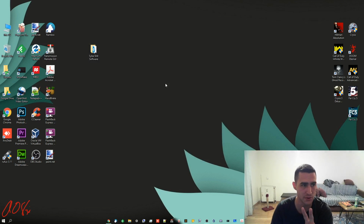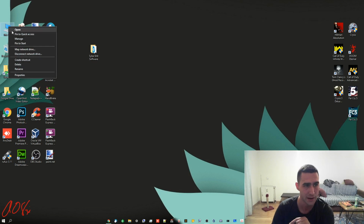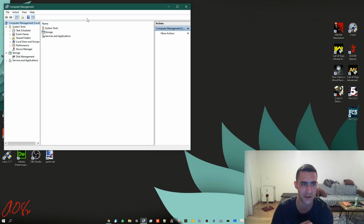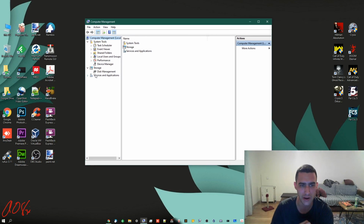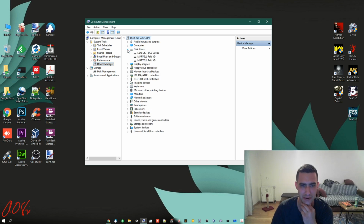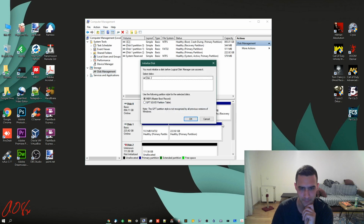So there's two ways to do this. There's one way built into Windows, I'll show you that first. To get there, you'll right-click My PC and come down here to Manage. Now you've got to be an administrator to do this, so I'm assuming that you're using an administrator account. And once you're here, you'll come down to Disk Management. So you've got, for instance, Device Manager, which will show a whole bunch of stuff, and actually, we can see this right here is the USB device that I just plugged in, so I know it's seen, I know it's showing up. But let's go to Disk Management.